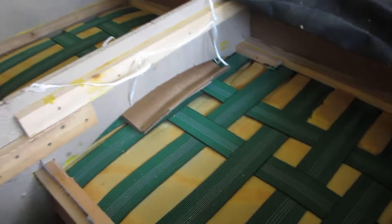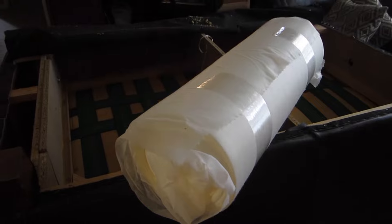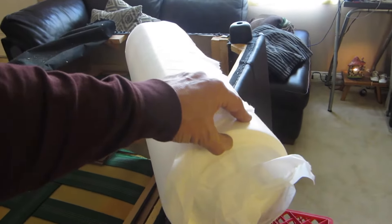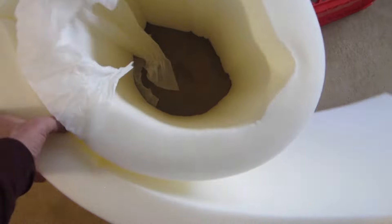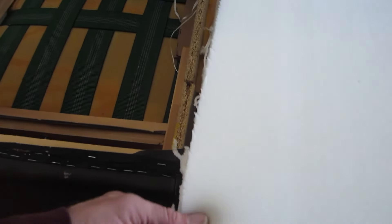The factory did have some support here that has disappeared, and the foam is now tearing from me having the pillow in. I'm just going to move forward with this as it sits. This is a $50 roll of high-density foam I got off Amazon — I'll put a link in the description — and I expect it's going to expand a lot once I cut it loose. Use a carpet knife with a fresh blade and just press down and cut right through it. You could probably use a box cutter but you need something a little deeper.